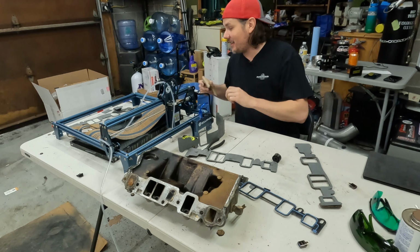And on top of it, I have the kit, which I have not installed. You can double the length. This thing is 450 millimeters by 500 millimeters, and you can take it out to 1,000 millimeters, where this thing will cut or carve or etch aluminum, giant pieces. I thought that I may need to go with the longer one initially to do the gaskets, and I found out for the V6 that this thing would do the gaskets perfectly as is.